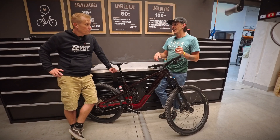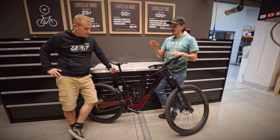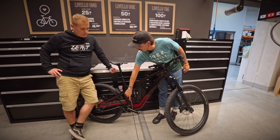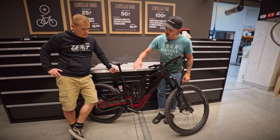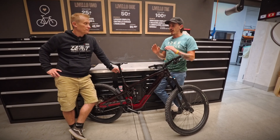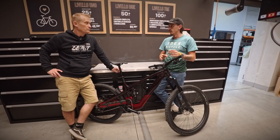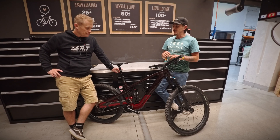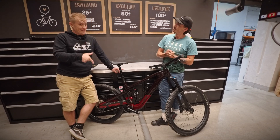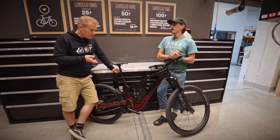The anti-squat is when you're pedaling, the chain doesn't lock the suspension out. On most suspension systems the chain influences suspension movement, mostly on enduro bikes. The problem with a high pivot is that anti-squat is heavily influenced, because when the suspension moves it moves a lot with pedaling. So we use an idler pulley placed a bit further up and forward, which gives an anti-squat value of around 100 — the same value we have on the Top Fuel 110mm bike. So this bike pedals really well because it doesn't squat the suspension.